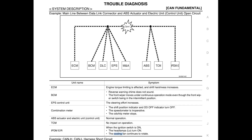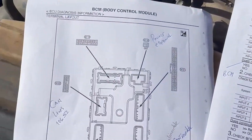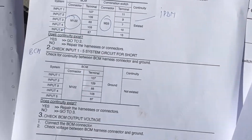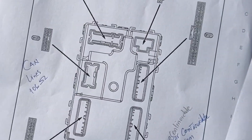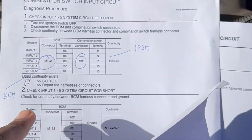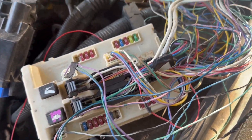What I had to do was isolate the CAN network. I started to test from the IPDM to the ABS module to the ECU — each module had to be tested. I used a multimeter since the CAN network is composed of two wires: CAN high and CAN low. I tested the continuity between those lines until I found the section where there is no continuity. I identified which connectors and pins are meant for the CAN connection on the BCM, ACM, IPDM, and TCM, which let me narrow down the number of wires to test.